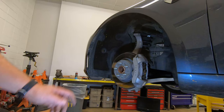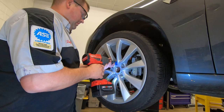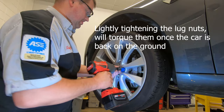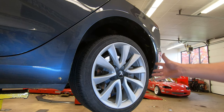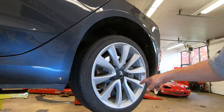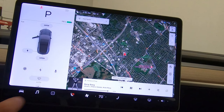Now that we've finished the front wheel service, put the front wheel back on. The rear wheel on the Model 3 is a little different — it uses a single caliper like most traditional gasoline cars, but it also has an integrated parking brake. When you put the car in park, the rear wheel is locked. We need to unlock that before doing the service, so we have to put the car into tow mode. Go to the icon in the bottom left, go down to Service, then go to Towing.